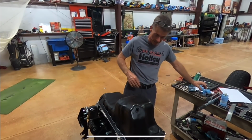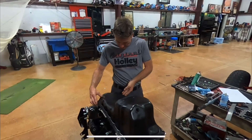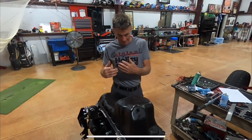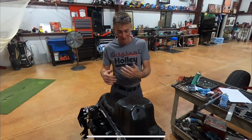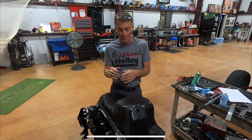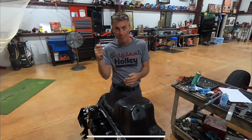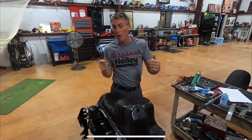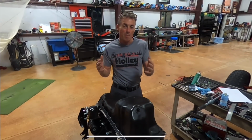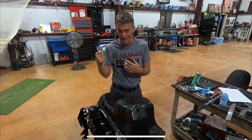And at one point, you will see Mike Klober, my crew chief, come in front of the car, and you'll see a couple of hand signals. One, he'll do that, and that is so I can check forward and reverse. Make sure that the car has ample clutch pack gap so that we have a neutral. And then the other thing he'll do, he'll give me a number 2. And what that means is I'm gonna grab a handful of brake, I'm gonna turn the fuel pump all the way on, I'm gonna take my foot off the clutch, and they're going to get a few measurements off of that of how far the engine RPM comes down when the clutch is out and the wheels are not spinning.